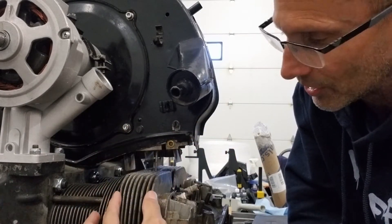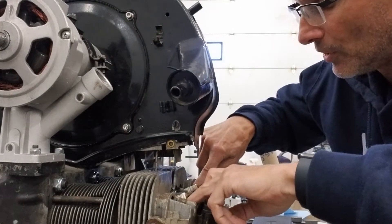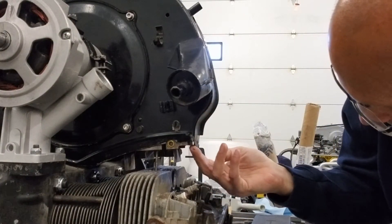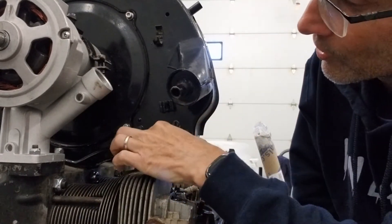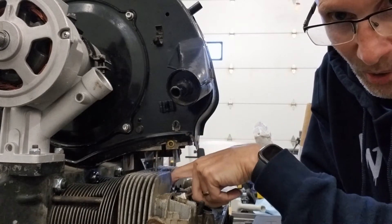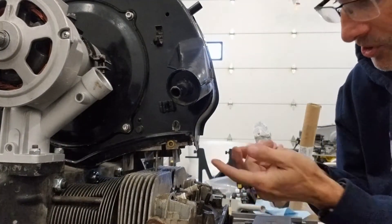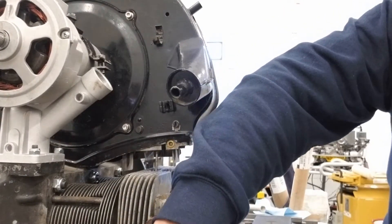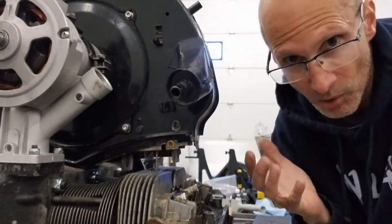Then this one is just slightly beyond that area of your cylinder head, so most of the air it's trying to put right in the center of the cylinder head fins. You still have a gap on this side which is then cooling through the exhaust side of your cylinder head. This part of the airflow right here is all for essentially the exhaust side spark plugs and the exhaust side of your cylinder head. The rest is all geared towards these fins right here, and of course through the center — and that's why there's a deflector underneath that you should have. If you don't have the deflector underneath you should have one, because it's going to push the air out this way on the bottom of the cylinder head, cooling this side and getting the bottom of the exhaust port side of the cylinder head cool, so you get more even cooling.